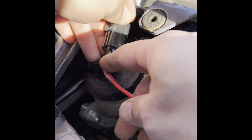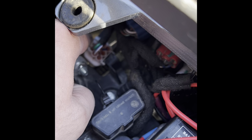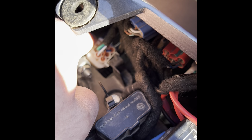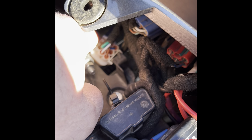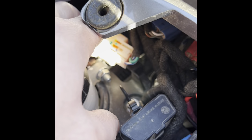And then if you look on this side of the connector, right down there, the middle wire is missing. There is an orange and an empty in the middle, and a blue. That blue wire would be the wire that CFMOTO would have used to actually add signals. You can tell it's in the middle, and the other side that we cut is also in the middle, and it's baby blue. Baby blue is the color you're looking for.